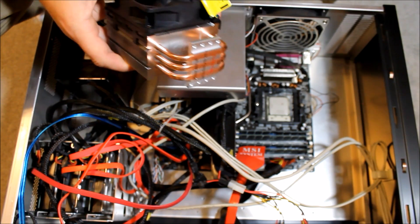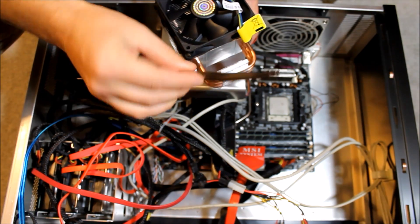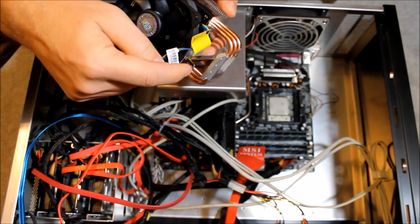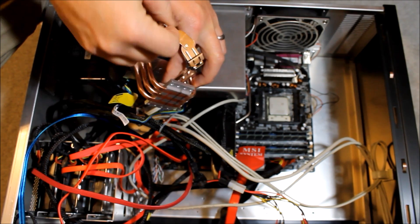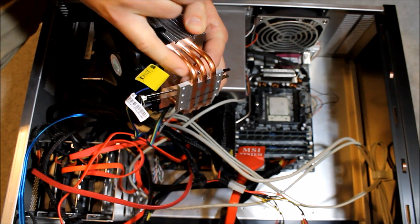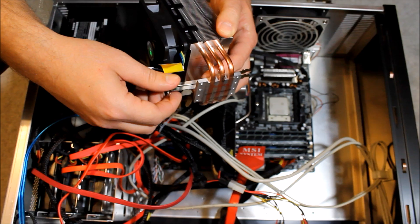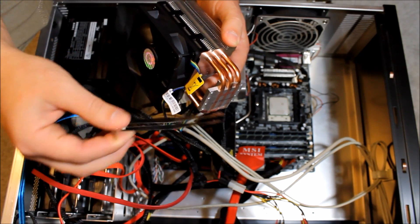So we've got our new fan here, and I'm dealing with a little older fan and older CPU socket. For AMD sockets, this fan basically has a little bar that slips underneath the fan, with notches that it slides into. It clamps onto a little hook on one side of the bracket, and the other side has a little cam that slides on and then when you lift up on the cam, it tightens it down. The instructions that come with the fan will show you pictures of how to attach your particular type, and you can look up walkthroughs online for every specific socket. This one is a socket 939 AMD socket, which is an older system.